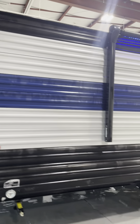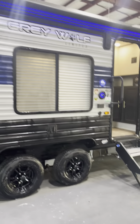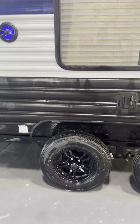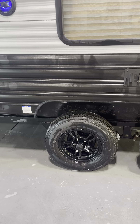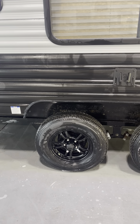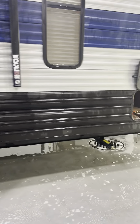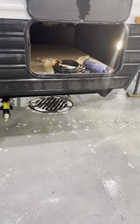Here's your 2126RR Grey Wolf. We got the wheels torqued at 120 foot-pounds. The factory's done it, we've done it, but you should probably also check it. Air pressure is up to 50 pounds. The awning's powered — that's just a push of a button. There's a quick connect up front if you want to run a gas grill; you can connect and run off the main tanks.